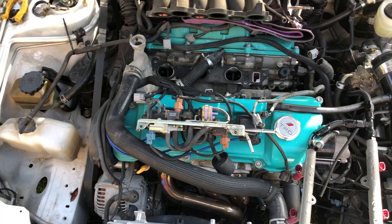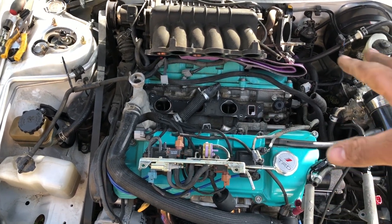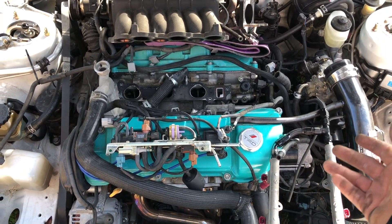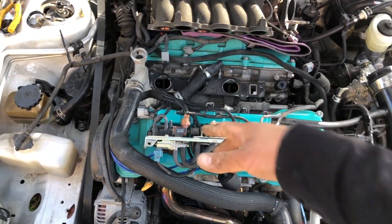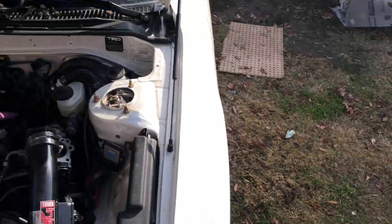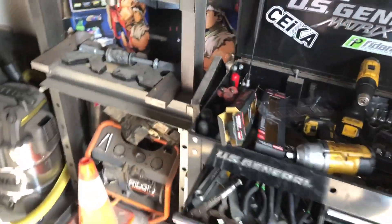This isn't a how-to video — this is me simply showing you guys what's out there, what can be used, and how we can fix this. For you guys out of California, you're more than welcome to use the knock sensor relocation kit, but at the same time you're not really monitoring the knocking of the engine block accurately because it's kind of out here and won't read as accurately as you want. So I'm gonna give this ATS knock sensor a shot. Even though this isn't hard to do, it's really annoying to get to.